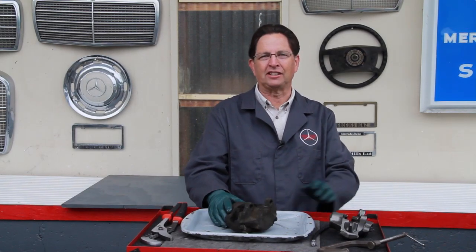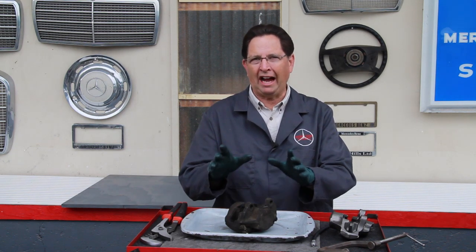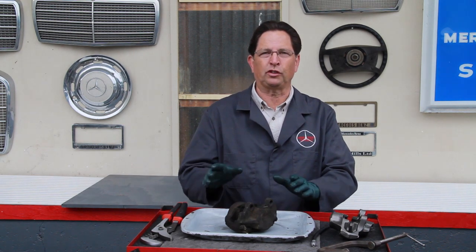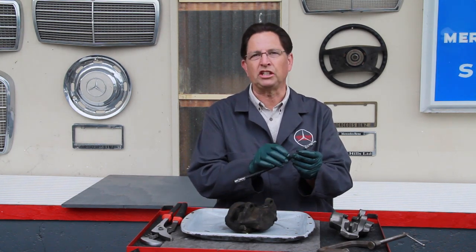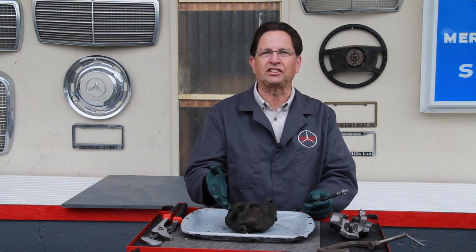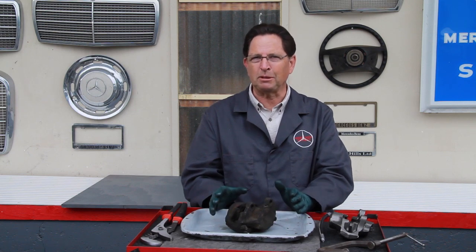Many of you have seen my previous video on testing brake calipers when they're on a car. In this video I'm going to show you how I test them when I take them off. There are many times when you might find a caliper dragging and you don't know which piston is dragging — you may not even know for sure it's the caliper. Sometimes it can be a flexible brake hose that has deteriorated internally, causing the brakes to stick and not release. I've had customers replace calipers only to find out it didn't solve the problem. So it's always best to take the caliper off the car and get it on the bench and test it before you start buying parts.